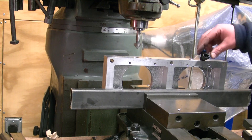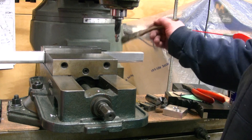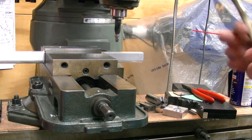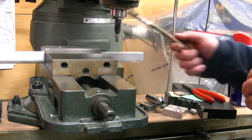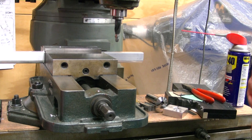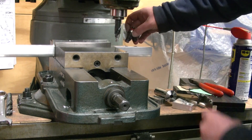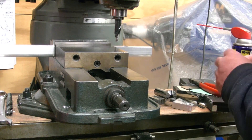I've got one of these trial fit on here, so the next step is to make up the fuel rail to go on there. Here's the fancy drill bit I bought — they want it to turn between 300 and 400 RPM, so I have it set at 300 RPM since my next step up is 595. I'm going to lube it with WD-40 and use a vacuum cleaner to keep all the chips out. I drilled that to a depth of 925 thousandths — seemed to be the perfect depth. Put the injector in to test fit. Boom. Perfect.